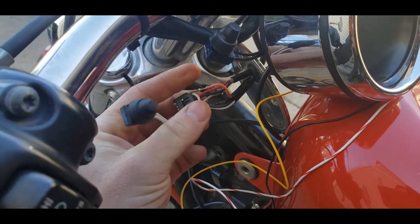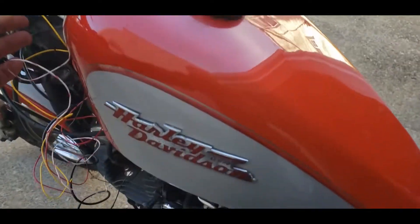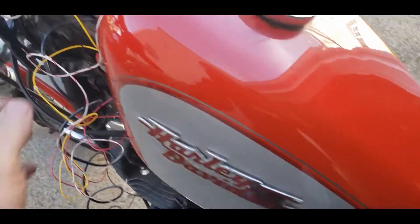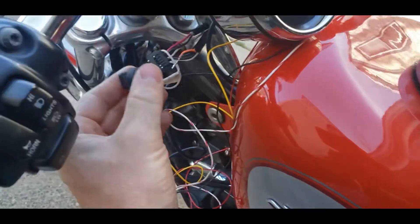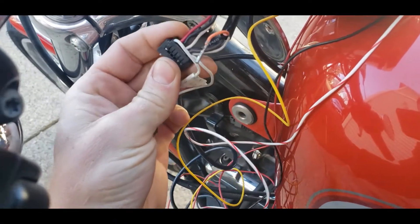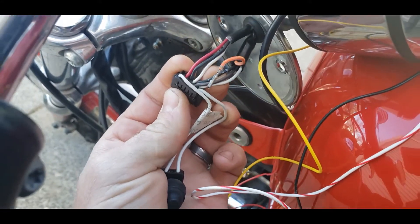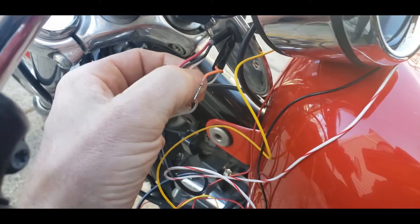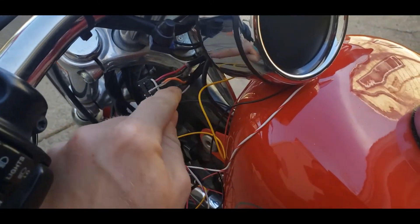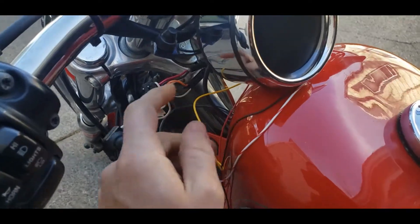The keyed power — I checked it with my voltmeter. These three — red, white, and black — are the original speedometer wires, so they travel under the seat to right there. That's coming out, and obviously the trip switch. One of these blacks in position eight, which I believe is that one there — it says BK with a negative sign in parentheses — I think that's gonna be my ground for the MLX.